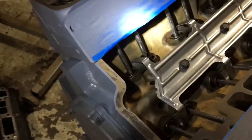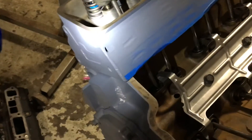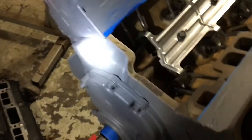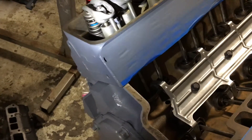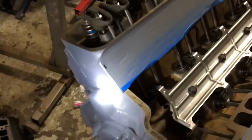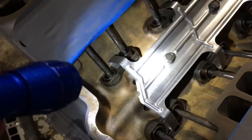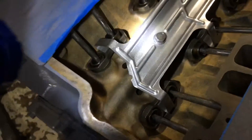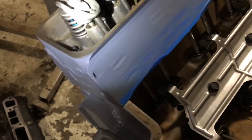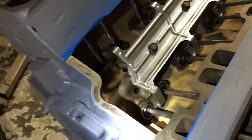As I'm tightening these up, I'm going to go through all eight cylinders and tighten all these valves in the firing order. That's another reason I do it this way - I like to inspect my valves as I do it. As I tighten them down and these valve springs compress, when I come back after doing all eight and inspect them again, if that spring is not pushed back up and pushed that plunger down, you've got a stuck lifter. The lifter is either corroded inside or something's wrong with it, because it won't compress. If it won't compress, you have no adjustability - it's going to either keep that valve cracked open or stay a little loose.